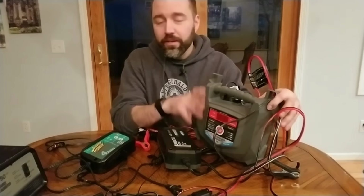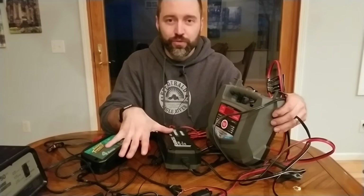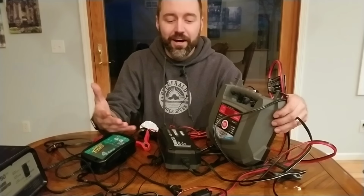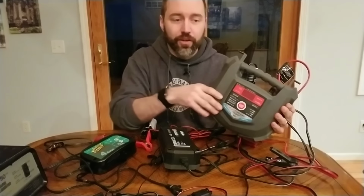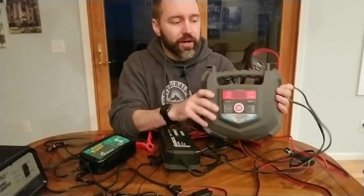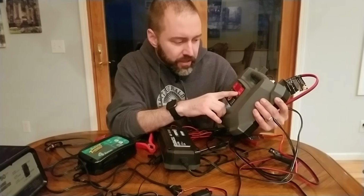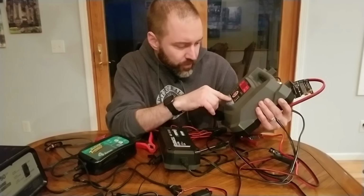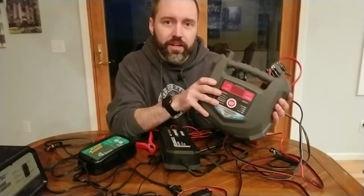However, with this one, I'm not trying to knock the company or anything, because my use for battery chargers for the most part is my indoor battery bank. Any of these brands will tell you that they don't want their charger used indoors. So I can't really hold it against them. What I don't like about this model, and I've tried several other amp versions of this, higher and lower ones, is that when you plug in the Schumacher brand, if it has the feature of a desulfation or an equalization mode, it will automatically try to desulfate or equalize your battery.